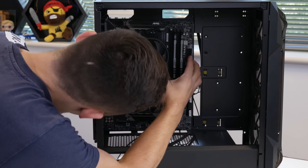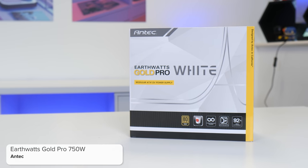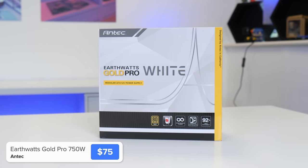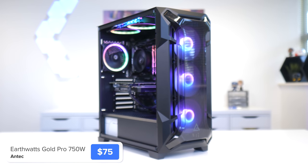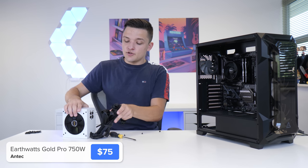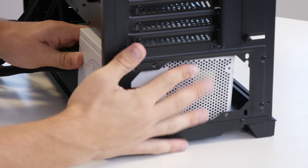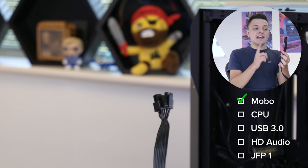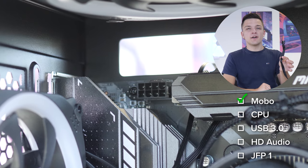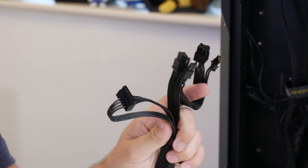We're going to slide the motherboard into the case and screw it down standoff by standoff. Next, while the motherboard is still easy to access, we're going to power everything up. This is an 80-plus gold unit from Antec, available in a range of capacities at a pretty reasonable price point — I'll pop Amazon links in the description. It's already got basically all the cables we need plugged in; we just need to add a SATA power connector. First up is the 24-pin motherboard power cable, which goes to the right-hand side of the motherboard. Next is the 8-pin dual 4+4-pin CPU power connector, which goes to the top left of the motherboard.